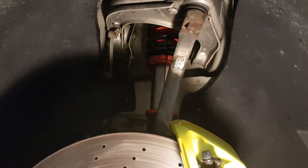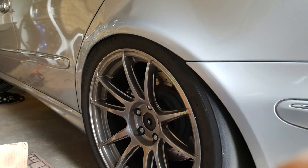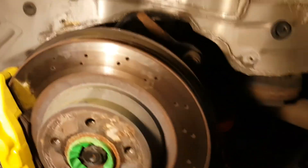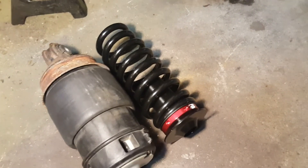The main problem after putting the front coilovers in and disconnecting the front airmatics was that the rear of the car dropped all the way to the floor. The airmatic system shares common air pressure lines, and when you disconnect one line, there's no pressure in the system at all — so none of it works anymore.